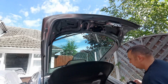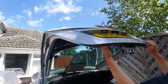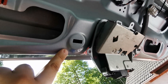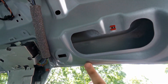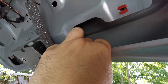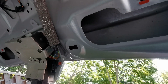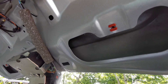There we go, wonderful. So we'll just lay that there for the minute. Let's just pull this boot down so we can actually get behind there. The dent is just probably beyond where this bit is here - I can just feel it right there, it's right behind this bit here. I'm presuming it's going to be the same on the other side, and the dent on this one is here - they're near enough in the same position on both sides, which is a bit of good news. They've got this little slot here so hopefully we'll be able to get something in behind there, maybe just like a bar or a bit of wood, just to try and pop that bit back out. Obviously I'm not expecting to get it right out but I want to get the majority of it out, so let me just get a hammer handle and we'll try and put that in there and push it out.